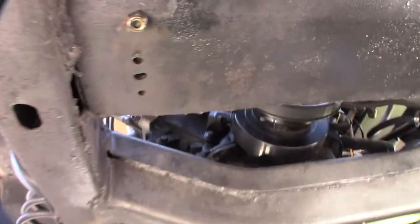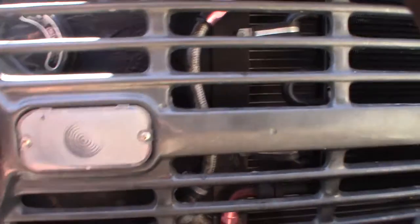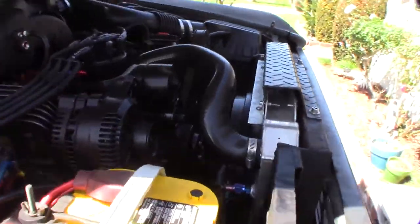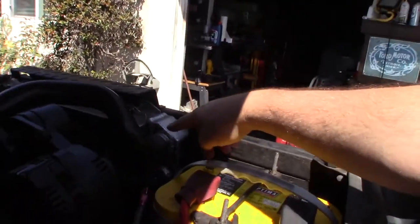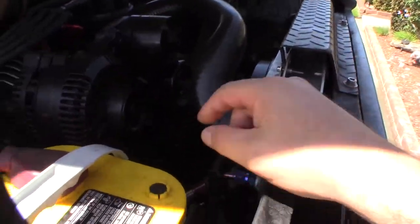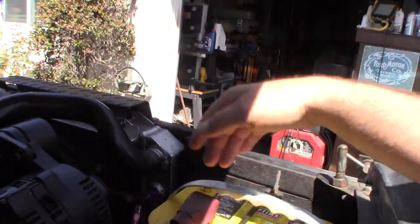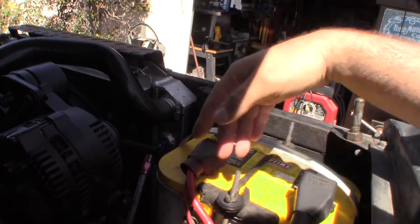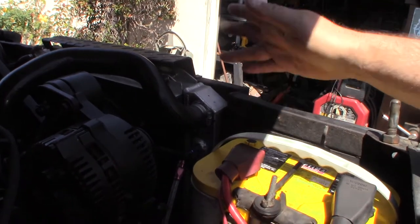It's hard to tell for sure, it's kind of dry now, but it's a little bit right there, so I can't tell for sure, but it seems like it's coming from the left side. This is actually a little cheapo aluminum radiator I got on eBay. It's a 5.0 radiator, meaning the inlet and outlet are on different sides, because I did the serpentine version and I had the reverse rotation water pump, so the inlet and outlet have to be on different sides. This radiator is probably not even a year old, from when I did the conversion and got that new radiator.